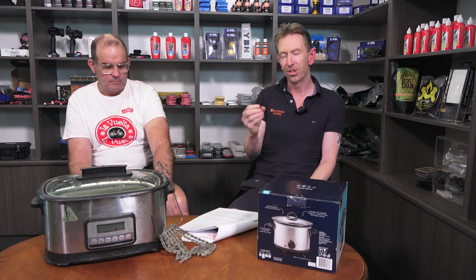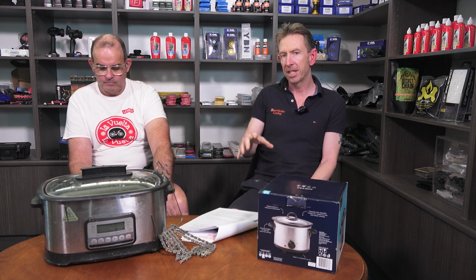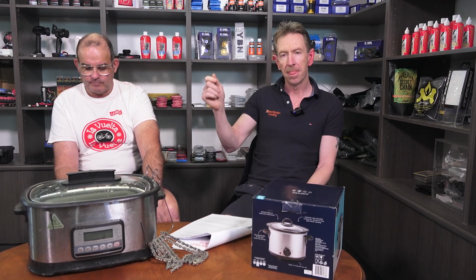rewax. If you've done a proper wet ride, then water is basically the transport medium to bring a whole lot of crap off the road. The water brings it right through the chain, and that abrasive contamination gets pressed into the set coating of wax. So if you don't do anything and just rewax it, it's going to import a fair bit more contamination than if you do a quick little boiling water flush rinse. So the recommendation if you have ridden a proper wet ride, be it off-road or on-road, is to boil up the kettle and swish the chain in an open container, same swisher tool as you use for waxing, just to melt off that old coating of wax, and it'll flush out most of the contamination with it. Dry the chain, put it on top of your wax pot and turn the pot on. So it's basically dry road, no cleaning, no need for any intervention.